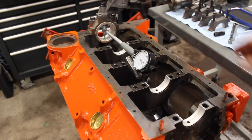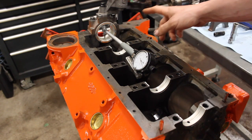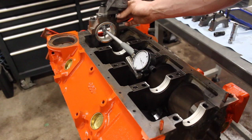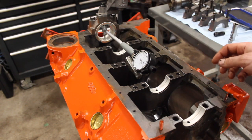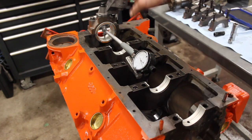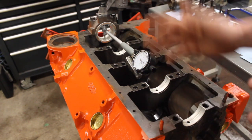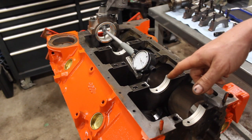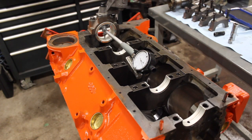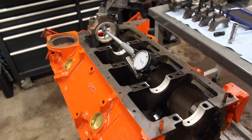So there you go guys. Let me know what you think. Is this something you guys do? Do you check with the oil pump on? For the guys that are using plastigauge, this might be an issue because you've got to torque the main caps down before you put the oil pump on since you can't easily get at that one cap bolt to torque it. So you've already squished that plastigauge down and now you've increased the oil clearance with the oil pump being on — and that's something you might not be aware of because once the plastigauge is squished, that's it. So this is only really something you can see with a bore gauge. When I'm checking my main bearing clearance with a bore gauge, I always have the oil pump torqued on there and check a few different spots to make sure we have the proper bearing clearance, because as you can see, the oil pump does make a difference.